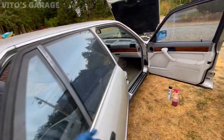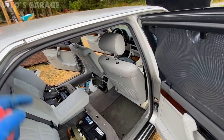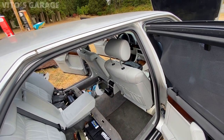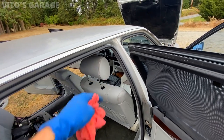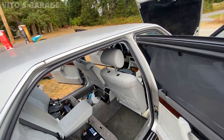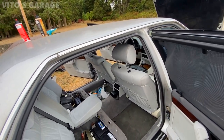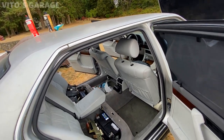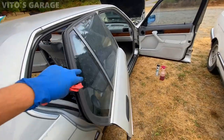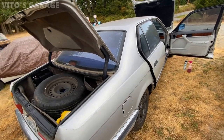Other than that, I'm also working. I have the left side rear seat out because we have a parasitic draw as well on this car. And what happens is that when you turn the key off, the window switches stay on and the illumination on them stays on, which sucks. So I printed out the wiring schematic, and you know, there's a general module right there that also controls them. So I think that I'm gonna start unplugging a couple of things one by one, and eventually I'll figure it out. But other than that, everything is amazing.